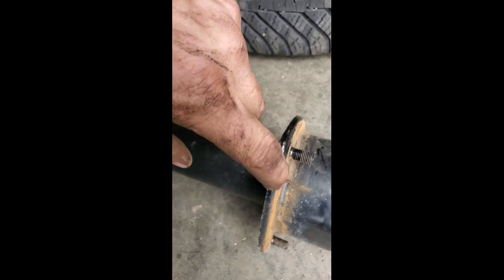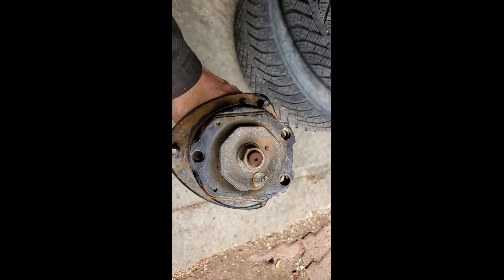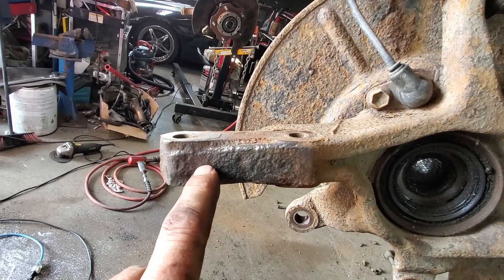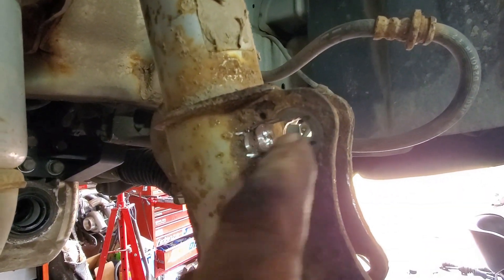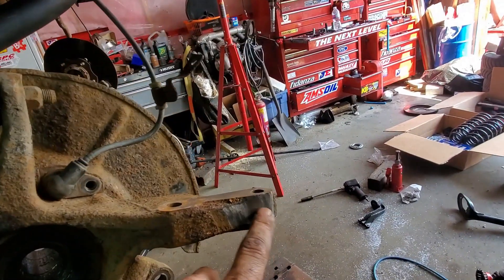For the strut spacer, they say you have to grind off this tang here, which is the alignment dowel. Make sure you get the alignment of the top of your strut right - the two bolts should be facing the inside and that one facing the outside. The instructions also say you have to modify the spindle by grinding a little hump on the casting flat. I already did that on the other side and what that does is allow the spindle to move in the slot we ground out so we can adjust our camber when the wheel alignment is done.